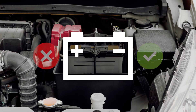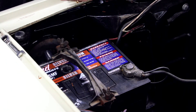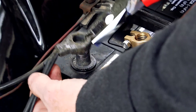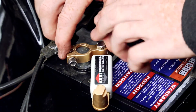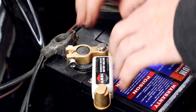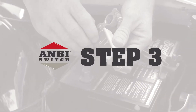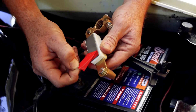Remember to never attach the Ambi Switch to the positive terminal. Let's get started on the instructions for batteries with standard size earth terminals. Step 1: detach the earth cable from the battery and attach the switch assembly to the battery earth terminal using the adapter on the fixed panel of the switch. Step 2: attach the battery cable to the post on the sliding panel.